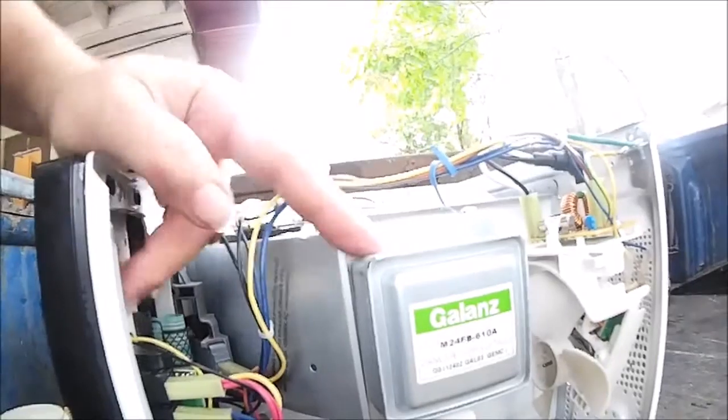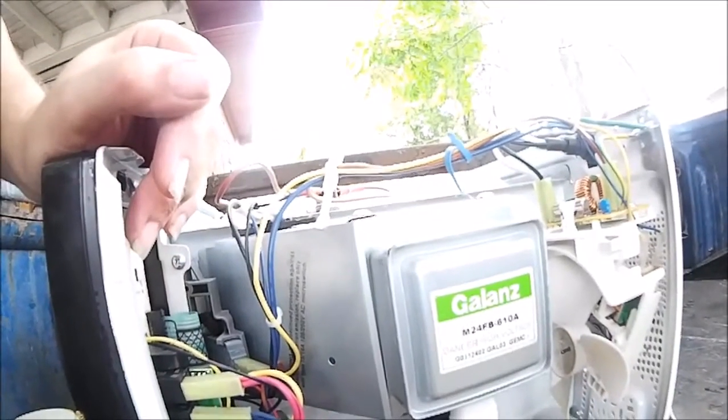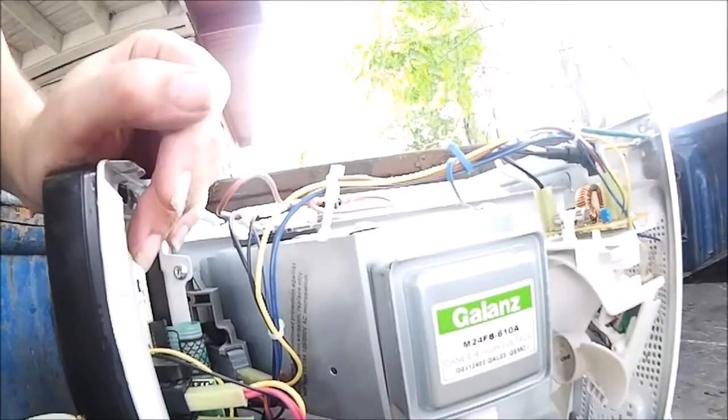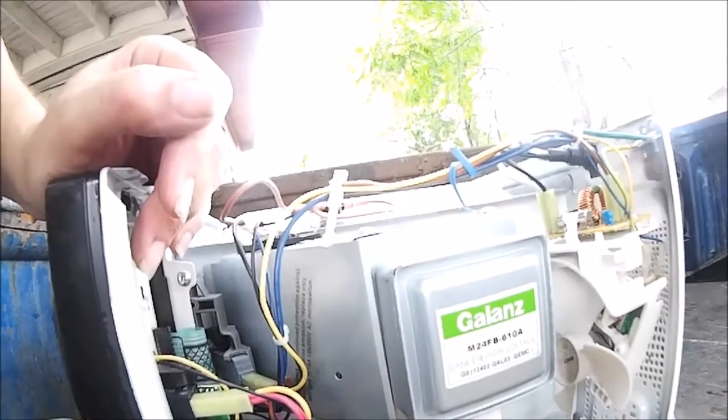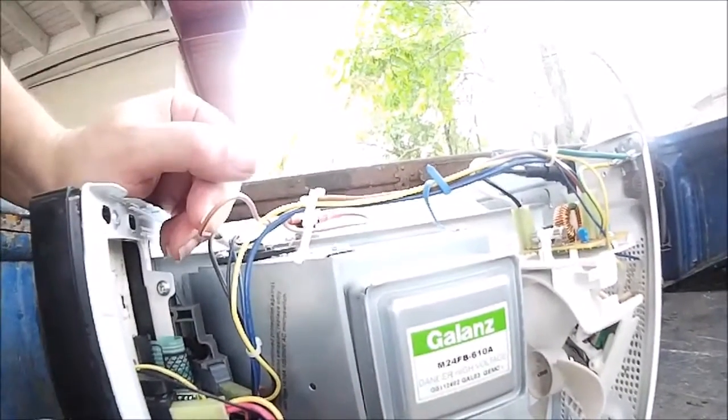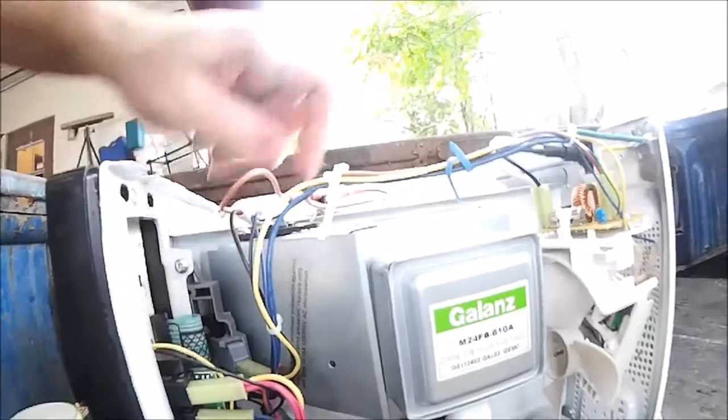This is the magnetron. This is where the magic happens. There's some pieces of metal and little wavy forms and big ring magnets in there, and power gets applied to this from the transformer. And that creates your microwave energy that gets shot into the box from here. It bounces all around inside the box. So this is nothing but a steel box. That's all there is to it.